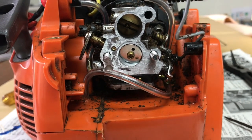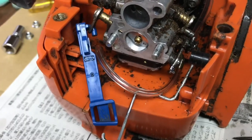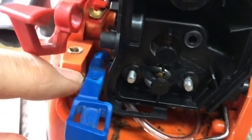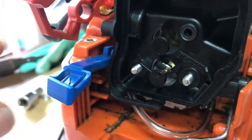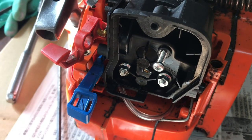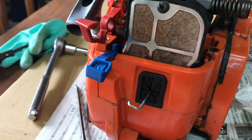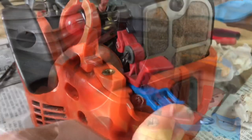It's time to fit the air box, the air housing. We've got the choke knob back on — note the location of the choke knob. It's in line with that level just there, on top of that black tab just under there. Otherwise you'll be pulling things out again. Next is this Torx 20 screw. We put back the filter, the cover plate, screw, and this back panel. Get this mechanism all properly seated before screwing it in, then check that this all works.